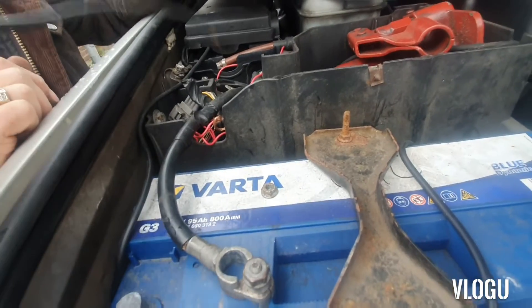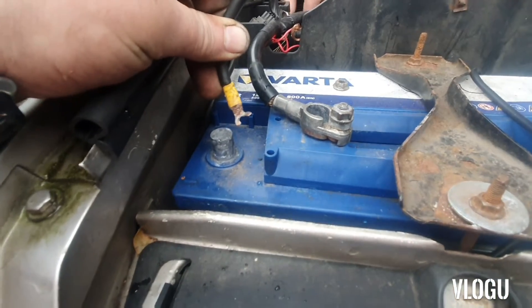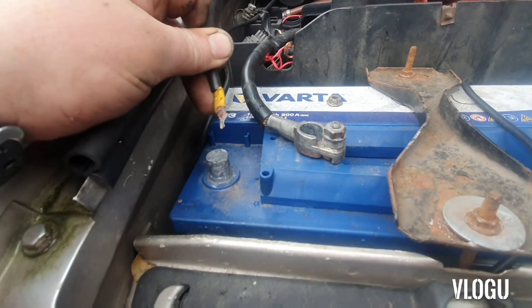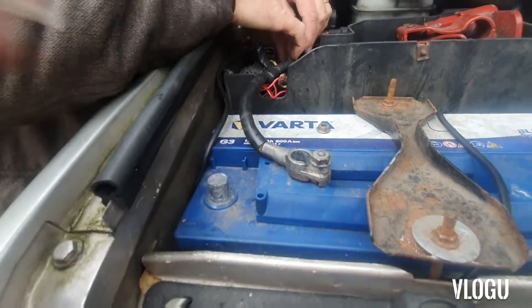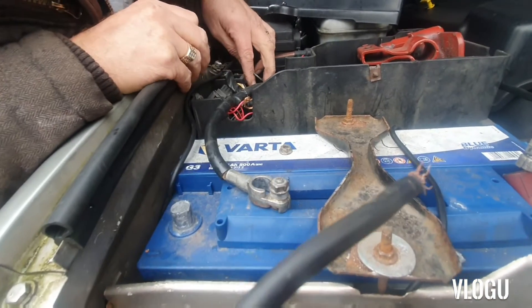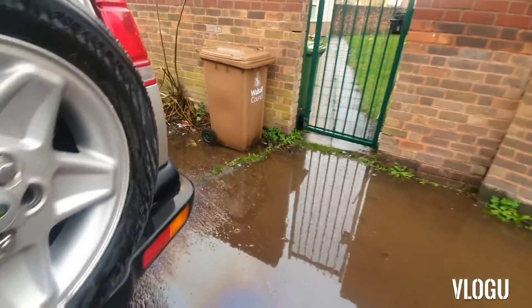It was just connected on under there, but we didn't put it back on because we didn't realise it was needed — it shouldn't normally be. But we're going to connect that earth back up and see if it starts, so we'll know it's definitely an earth problem. We'll also try to find a better bit of wire because it's not really long enough.